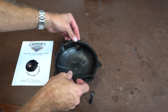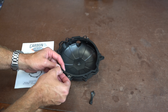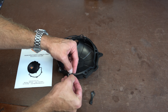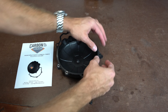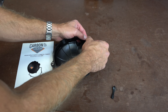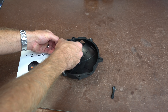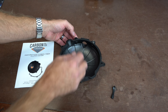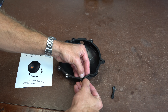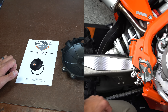Now that we've got that down, we're going to line up our gasket. Just make sure it's clean, doesn't have any dust on it. Line up the gasket right over those sleeves — you don't want the gasket to be pinched by the sleeves, and you don't want to push those sleeves any further than what they go with the insertion tool. According to the Carbon Up guys, if you don't do this procedure properly, it is definitely going to leak. Take your time and make sure everything is down perfectly and not pinched at all.